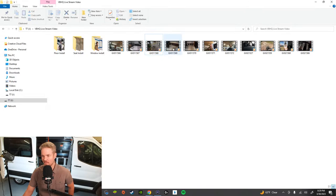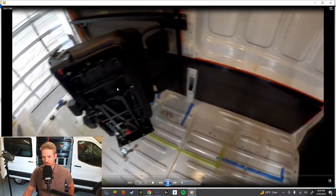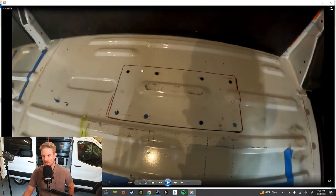My light goes out and we end up back inside. I've taken the seat out — the seat is extremely heavy, by the way. Now we have our footprint of where we're going. You can see where the seat has rubbed, where the corrugation is. Now we are shimming this seat up in these holes — I actually have two more holes I've got to drill after the fact, as they're hard to access with the seat on. So we've got 10 holes with grade eight bolts — extremely strong contact to the van.